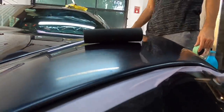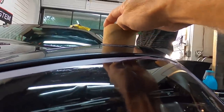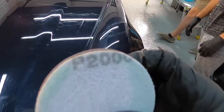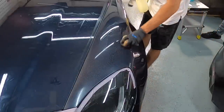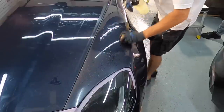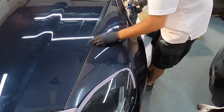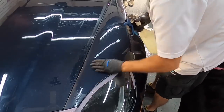We're going to use the wet sand method. You can use a flat block if you're working on large flat areas, but for the curved contoured areas, this foam block will contour to the shape and help make contact between the sheet or Trizact disc and the panel. You can either have the sheet or Trizact disc pre-soaking in a bucket, or just douse it with water and douse the panel as well. Starting near me and pushing away, getting the residue away from me — I'll often spritz water onto the panel to keep it clear of residue and keep my work effective.